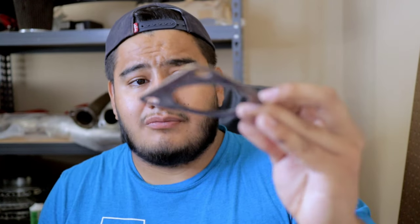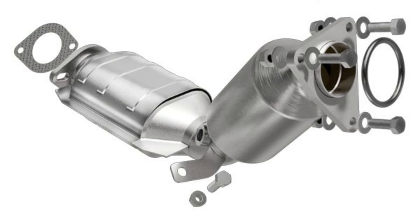I know some of you guys are going to probably say in the comment section that the VHR does not have a triangle gasket that comes from stock, and that's true. They use an O-ring style of a gasket. However, you guys can make these triangle gaskets seal, and I'll show you guys what I have here that I've used personally on a DE, and it has worked great.